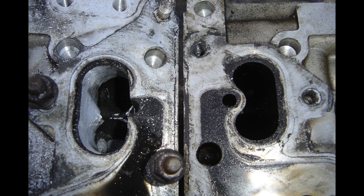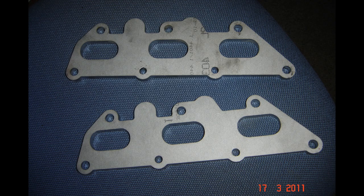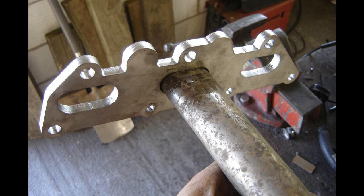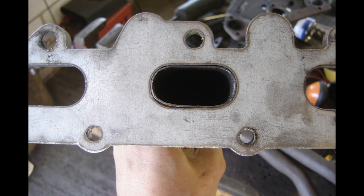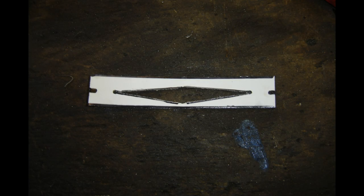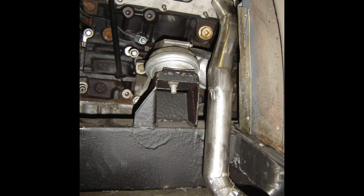So it's the exhaust porting, the injector base plate restriction removal, and these headers — those are the real big ones. I got these flanges off eBay for an X30XE — 10mm stainless steel plates which bolt on each side of the engine. I used the old exhaust system from the Scimitar, which was one and a half inch pipes, making sure they were 27 inches long. I cut them five degrees at a time with a little template, bent the steel, made sure there were no burrs inside, then welded it up — fairly decent radii throughout.